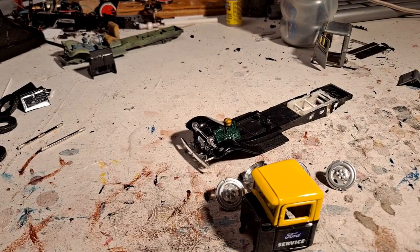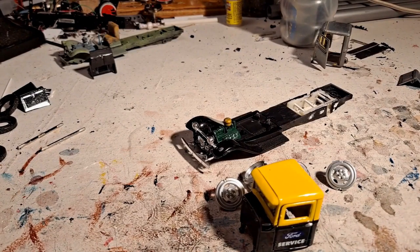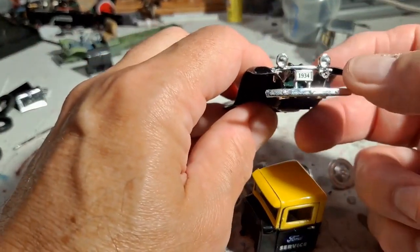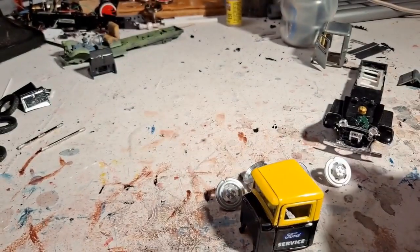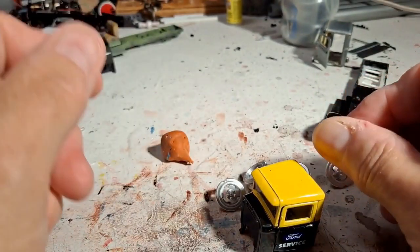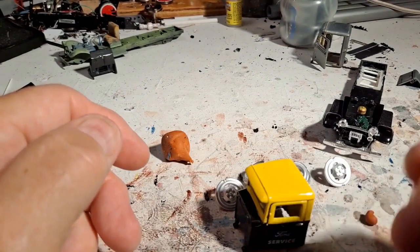Use it in a well-ventilated area. You can use whatever stripper you want — whatever you're comfortable with — darn near anything will take the paint off these. The cab enamel is fine; the plastic on here for the most part isn't harmed by strippers. Do not get any stripper in the headlight lenses whatsoever. When I do these, I always take a piece of real clay — not play-doh, this is real clay, the stuff that never dries.